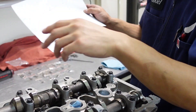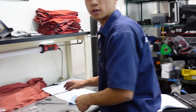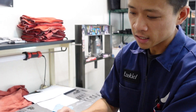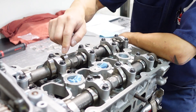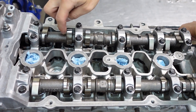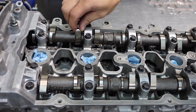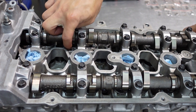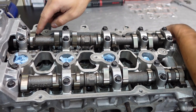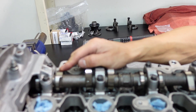So that means I've got to turn these 180 the other way to be able to measure cylinder 4. Another word of caution: the most accurate way to know where the lobe should be for valve adjustment is by the timing marks. Because if you look at this, you notice number one — this is like at the side of the lobe, and this is actually at almost the bottom of the lobe center. This lobe orientation is more what I'm used to for where the lobe should be to measure valve clearance, but this is kind of an oddball for me — and this is also the cam lobe position the service manual wants you to measure the valve lash.